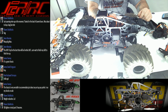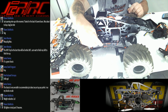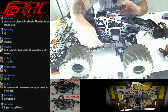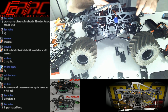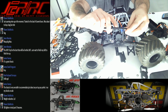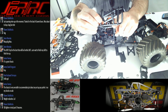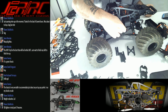On the right-hand side, it does not line up properly because of the way the transmission sits in there. It's a slightly different setup. But on the left side of the truck, it'll actually mount as it's supposed to. By flipping everything around, and I shifted things around just a little bit, the bottom hole right behind the header on this side doesn't line up properly. The intention was to leave that as an option. My thing was going to be to just cut. If you look at this here, you have the tripod pieces, there's three, is to cut it off right behind there, just to mount underneath the receiver to give it a little bit more stability.